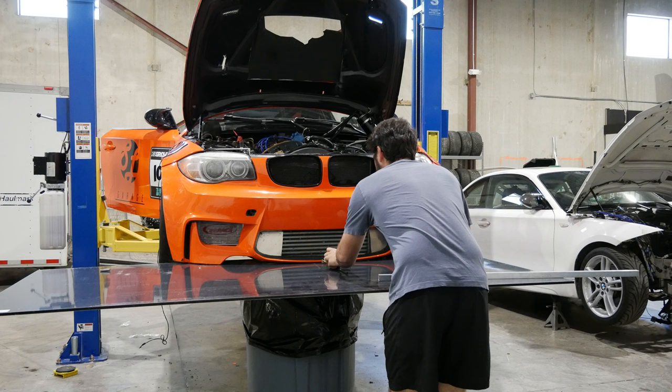That will help keep it in a fixed position, because the rods have a little bit of play, and they can move. So you don't want to have that free motion in your splitter or it's just gonna chatter and destroy itself. So definitely want at least two fixed mounting points. At the back is definitely the best. That might be a lie. Realistically, I probably should have done back and coming down here for solid mounts. And I think I thought about doing that and I forget why I changed.